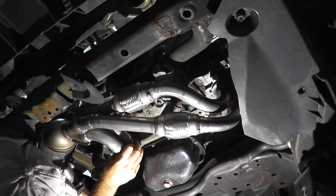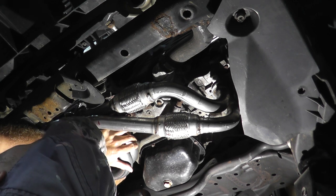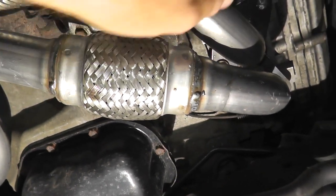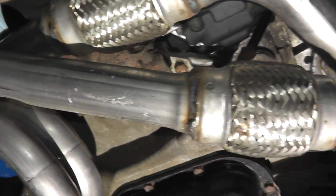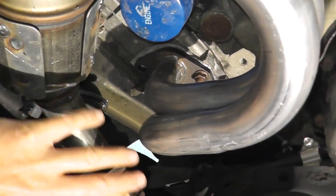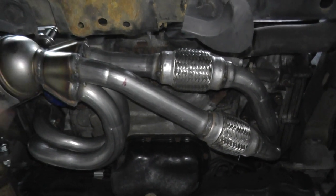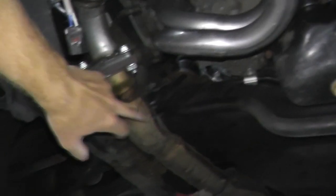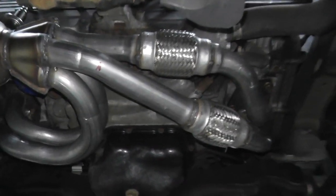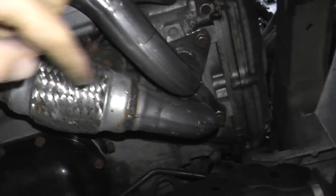Let me grab the fasteners. If you can have someone hold the converter for you, that will certainly help. As I was installing this converter, I had it angled slightly but the gasket was holding — that's because I used a very small amount of super glue, just a drop or two, to hold the gasket in place. It'll burn off once the vehicle starts. Two things before we lower the vehicle: one, you'll need to purchase a heat shield if you want to reinstall one — it's mainly to prevent tall grass from igniting. Two, when installing the converter, don't start by over-tightening each fastener and moving on to the next; loosely install all nine fasteners first.